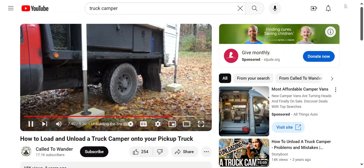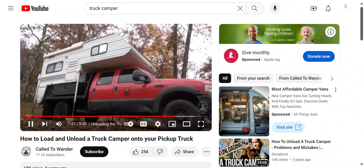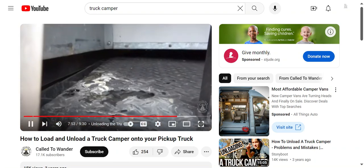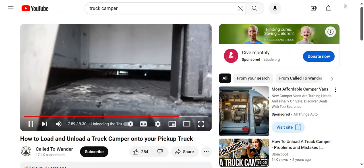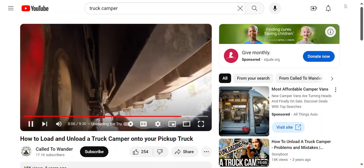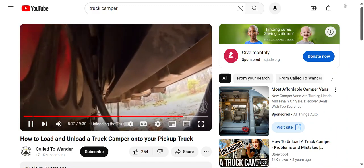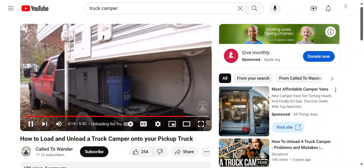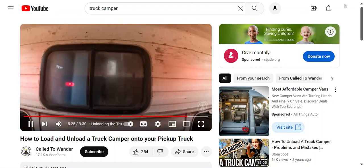The next step is to raise all jacks until the camper lifts off the bed. It's very important to check all points of contact with the bed. Depending on how level you were when you parked, check the very back and front of the truck bed, as those are the places most likely to snag if you're not completely lifted. At this point, unplug the camper electrical harness from the truck — disconnect any zip ties or other points of contact between the truck and the camper. Then start your truck and move slowly forward, checking your side mirrors constantly to ensure the truck isn't hitting anything or clipping the jacks.